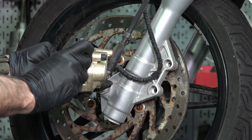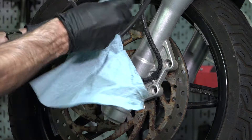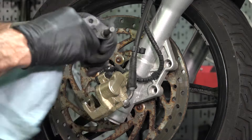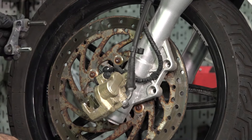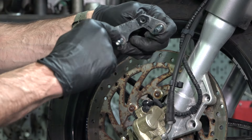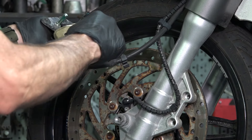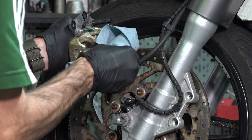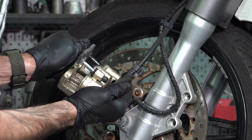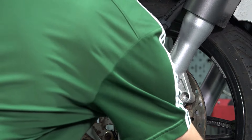So we're going to go ahead and lubricate the slide pins. Pull this off — make sure you don't tear these boots because they aren't available as a replaceable part. Kind of wipe these, make sure none of the dirt gets in there. You have these pair of pins, go ahead and wipe them free of grease. You don't need much grease at all, but the Maxima waterproof grease — which is the ScooterWest grease part — just put it on the pins, just a light coat. They kind of have some flats that retain some of that grease. You can put the last little bit into the boots, but make sure there's none of the grease on the outside of the boots because that might get on the brake pads.